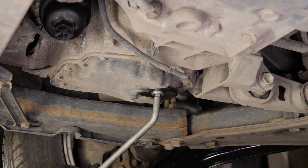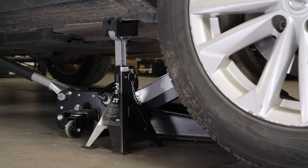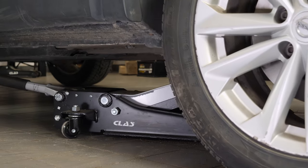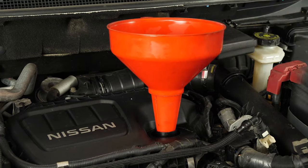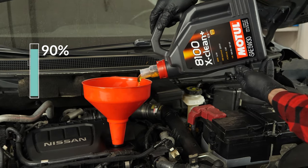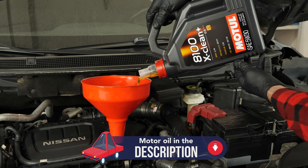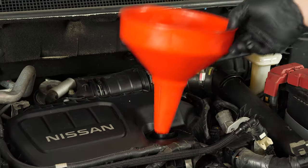Now you have to put the oil back into the motor — be very careful and precise when doing this part of the job. First, put the crankcase back in place, then lower your car back to the ground and check the oil level. This can only be done when the vehicle is flat. Begin by putting in 90% of the suggested amount — this will leave you a large enough margin to adjust the level appropriately. You can find the exact amount of oil suggested for your car in the description of the tutorial.